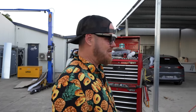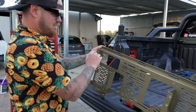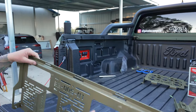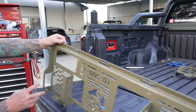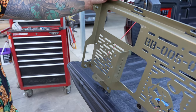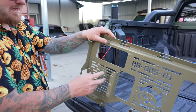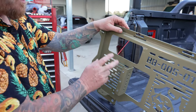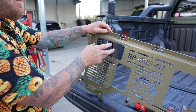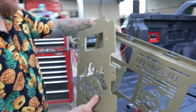This panel here is our backing piece — it's all marked up because I've been using it for weeks. This panel goes onto that back wall to support the battery. Down this side is where we mount our BC DC Red Arc, and the face comes out there. We've made an allowance to put your midis up here as well as your BC DC. Your light comes out here.